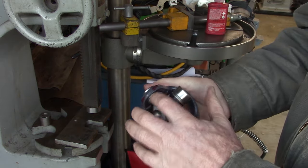I need to just tap it a little bit in that direction. I brought our block over because I want that end of the cap to be floating free. Check it — give it one last tap on this side for good measure. They do make different thicknesses of these c-clips, and I've even had to put them on the belt sander and take a little off — especially if these yokes get sprung like I showed in the disassembly process. If you don't put that brace in there, it's easy for these to get sprung, so keep that in mind.